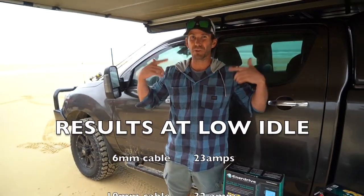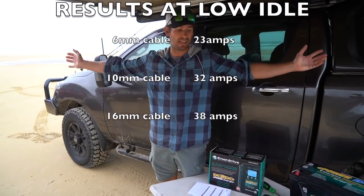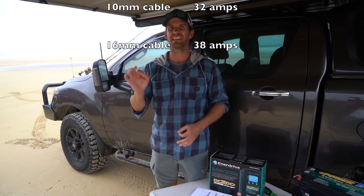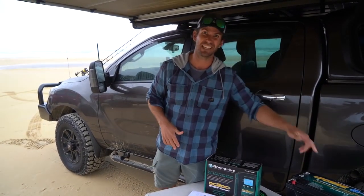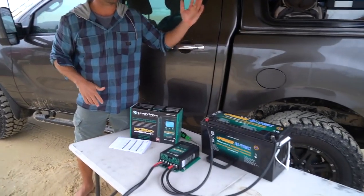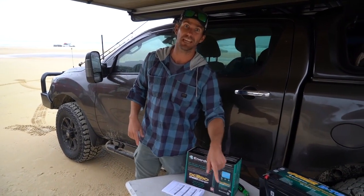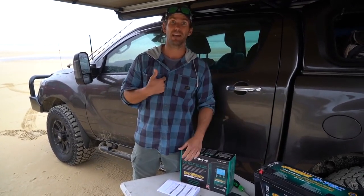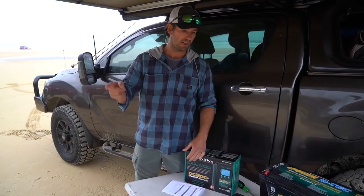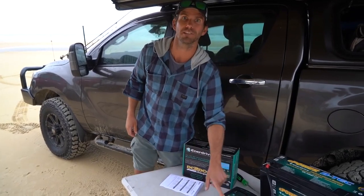There's the difference. It can be a bit confusing to understand voltage drop just because of cable size, but when you've got 10 meters of cable, you lose that voltage to this unit, which means you lose the output in amperage to your battery — which means it's going to take longer to charge up and it's not going to run your fridge as well. Cable up the best you can. Make sure you get the most voltage you can to this unit and it'll perform the best and charge your battery the best. I hope this helps you out — it'll be good for your DIY installs. Now you'll know what cable to buy and what gear to use. Cheers — any questions, drop them in the comments and I'll get back to you.